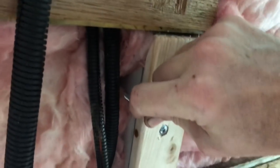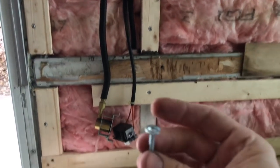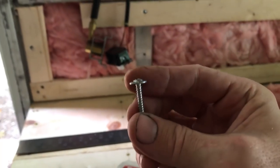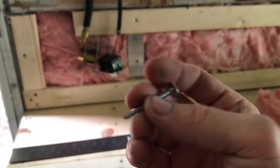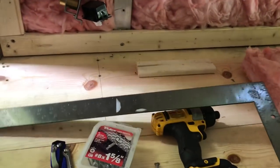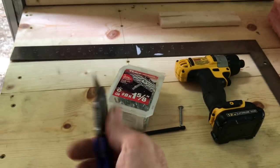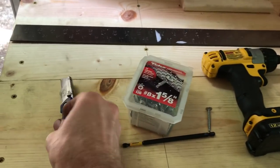Something you always want to check is that the distance of your wood into your metal does not go through into the side of your vehicle — I have seen that done and it is disastrous. This self-tapping screw has a fat head so you have to really drill it in and sink it. You don't need a tape measure for this, but you do need a straight edge — metal is helpful — and all you need to cut it is a nice sharp razor blade knife.